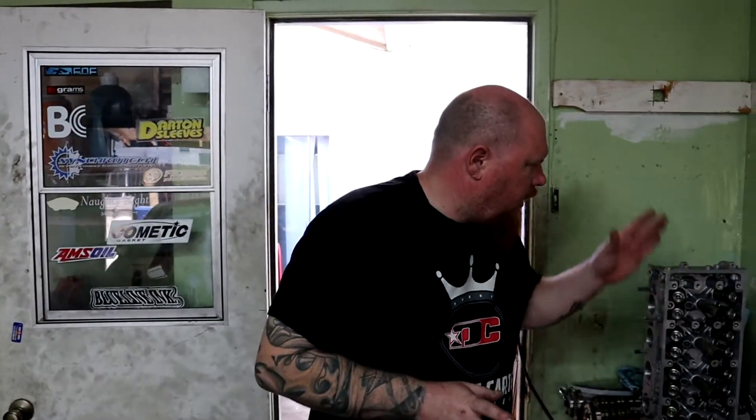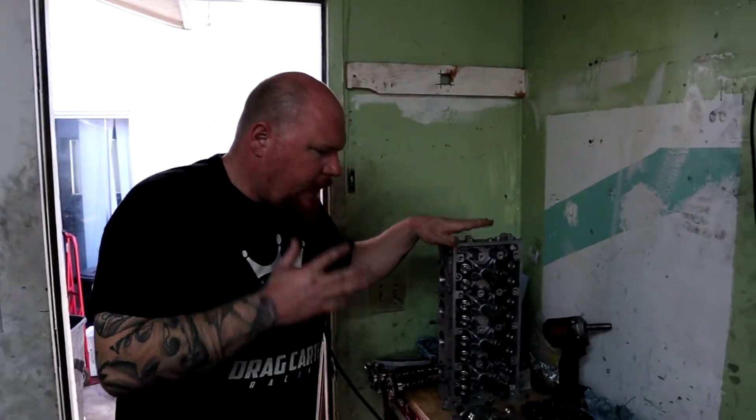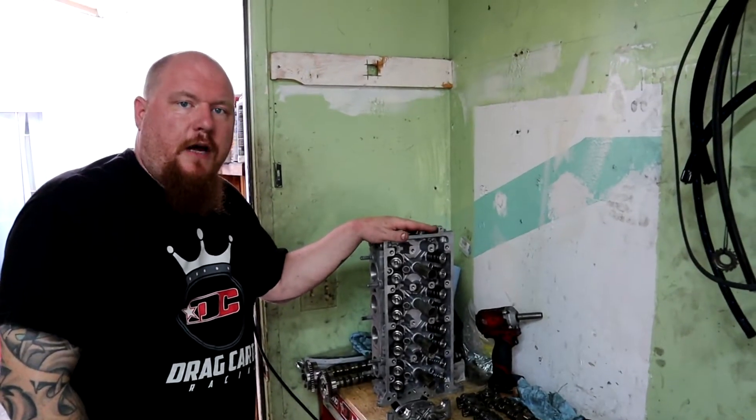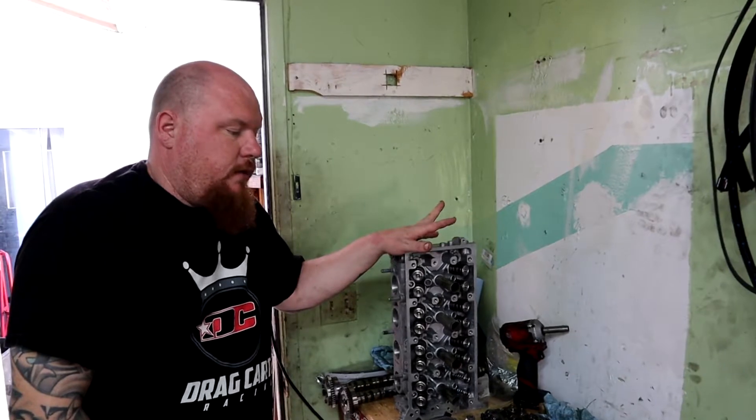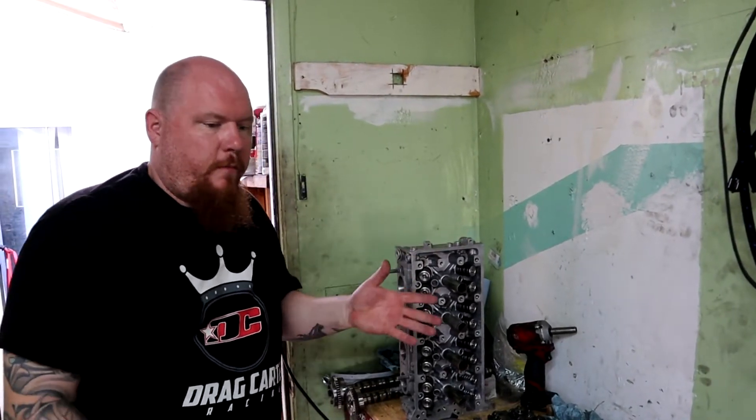So today, more of a tutorial than anything, we're going to put the head on and also check the valve clearance on the intake valves to make sure that I have plenty of piston-to-valve clearance. When I'd taken the engine apart before, it looked like there was some signs of maybe the valves touching. I had some Drag Cartel stage one cams and they have more lift and duration, so you can't clock the VTC all the way. I'm just going to check it for peace of mind so I know exactly where I stand.